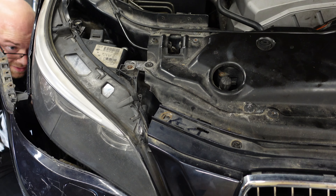Before you realign the bumper, when you go to put it back on, do remember to tighten all your bolts at the top to pull the bumper in before you stretch it around the fender. Otherwise it will just be uneven all round and it'll be sticking out at points. So just tighten the ones up here to align it and then wrap it around the bumper. And that's the LCI retrofit done, at least on the headlights. That is how simple and easy it is to actually do it.